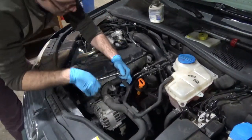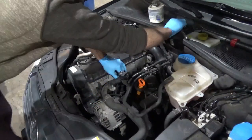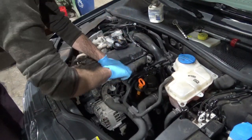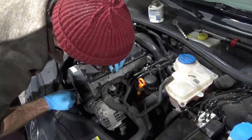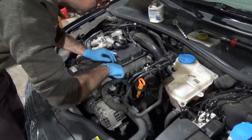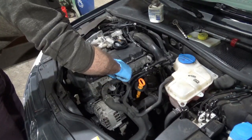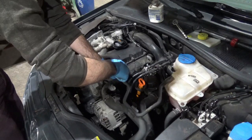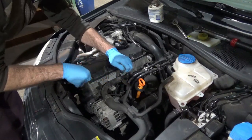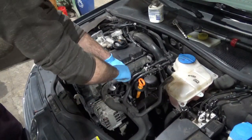I always like, with stuff like this, especially an aluminum fastener, or a steel fastener, even though these are some alloy, a stainless or something. I have never personally broken one off, but I've dealt with the aftermath of one being broken off due to dissimilar metal corrosion. And when I'm dealing with sketchy fasteners, I don't slowly torque, but just pop it, like with an impact gun.